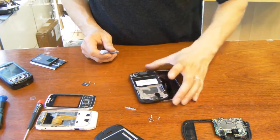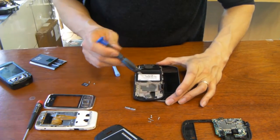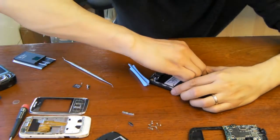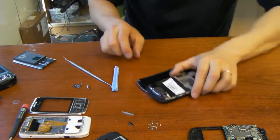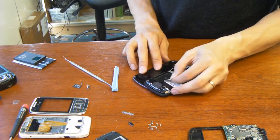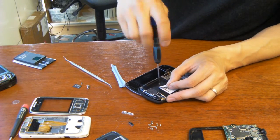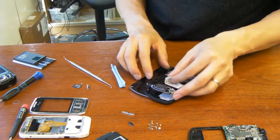We've got the main circuit board out of the phone. And I noticed one screw, two screws, and I think those are for the sliding panel. What's holding it actually is a screw behind the white label, so you want to make sure you peel the white label — there's a screw right behind that. It's a little tricky here. Once you undo the screw, voila, the back panel comes off.